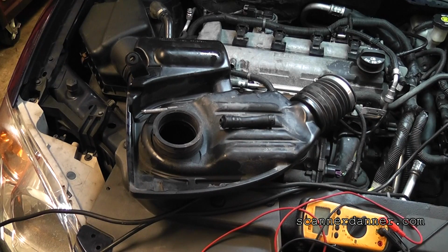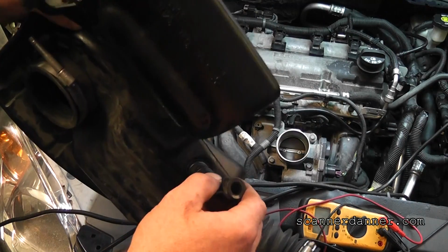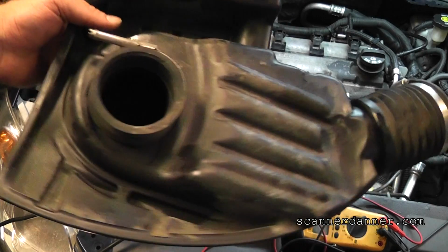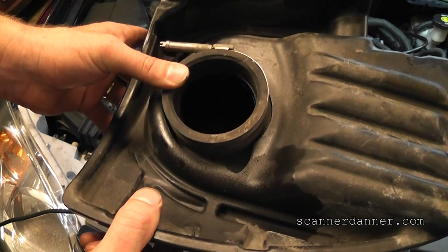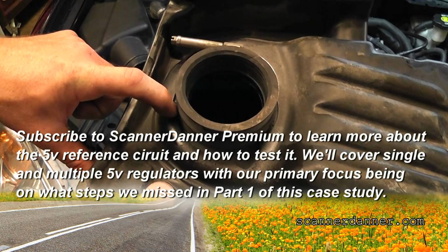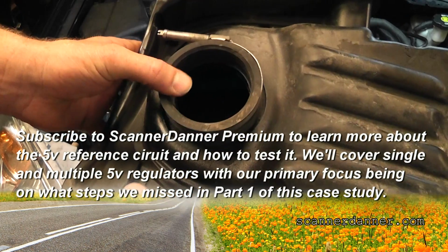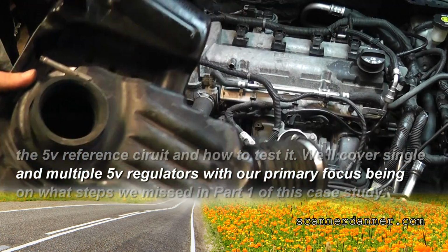All right, I couldn't let this go, guys. Just want to get a final shot. Guys, listen, please. This is the tube that we were talking about. That's our PCV line, and that goes on the front of this right here, and that metal part is broken off. But here's the other part of the lean condition. My concern was when we were blocking this off, we couldn't get the short term to go way negative, and here's why. The entire housing is broken right here. So this is air entering the system outside of the mass airflow sensor, and that makes sense. As we were leaning on this, things were changing. That housing's busted. So we'll replace this housing, and then I will do a final shot of the fuel trim on this.